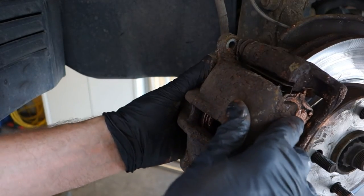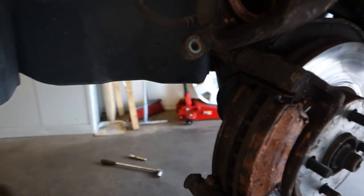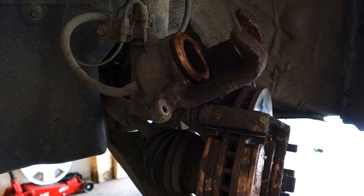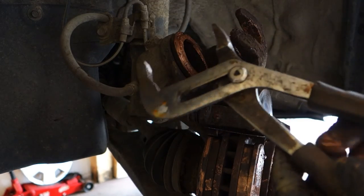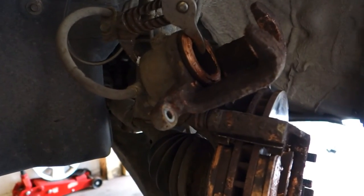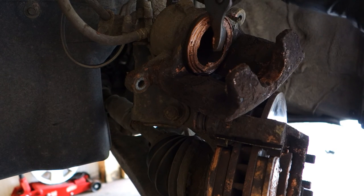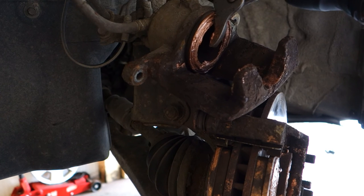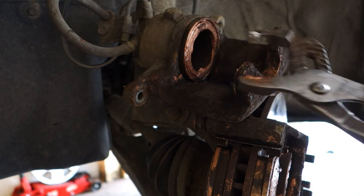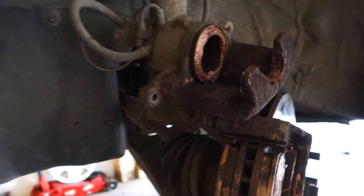And it happens that when I press that in here, and then if this is difficult to install in here, we can take our big tongs, and a little bit, I need to compress this my brake caliper cylinder back, and big tongs, and then big mount, and then I insert that and only in that position in here, look in this way, and then I press and look how this goes inside. Now a little bit better position, and when I press, it goes nicely in there deeper. Okay, now it's in there. And then be careful that you don't hurt your fingers, and do not damage this rubber, because it's important part.